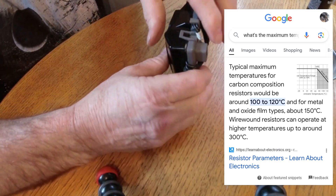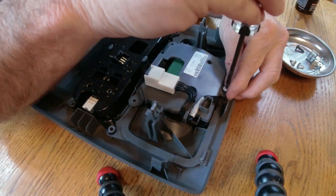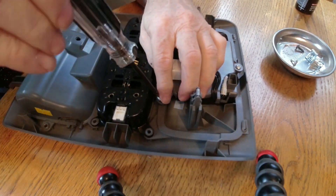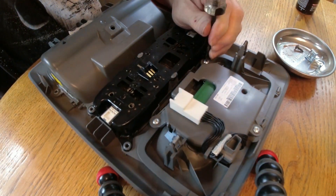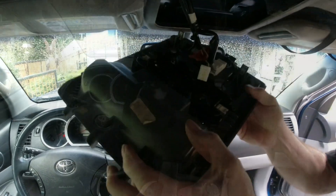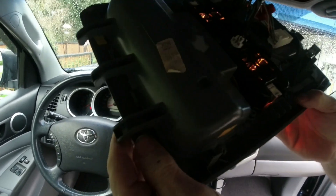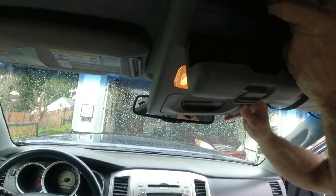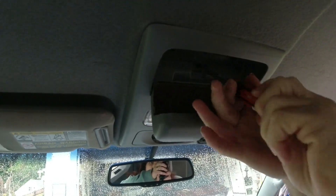Snap your two plastic cases back into place. Then use those three screws to remount the display onto the assembly. Hook up the two connectors. Don't forget to reinstall those mounting clips you either found or purchased. Slide the back of the panel into the headliner and then snap the front into place. Finally, drop the sunglass holder and reinstall that single Phillips screw.